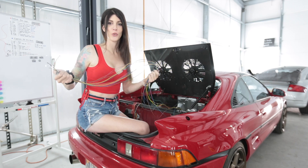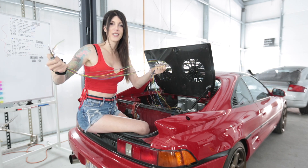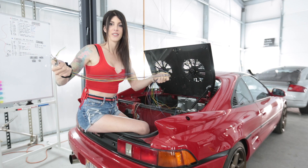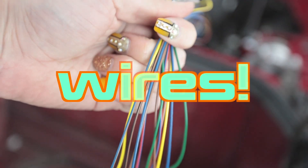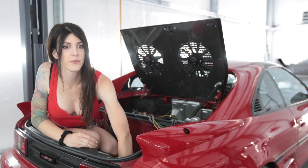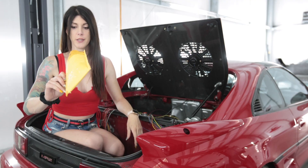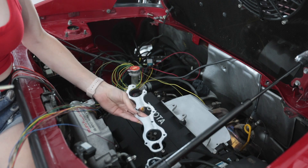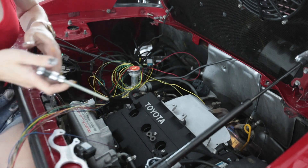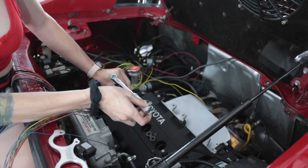I'm trying to keep it as clean as possible, but I don't know where else to stick the wires for the coil packs, injectors, IACV, and TPS — there's like nowhere else to route it, so it's not that big of a bundle. Somewhere down in my trunk of goodies — these right here are more Toyota OEM plugs, all for those circuits I just mentioned. Really wish I would have thought of this yesterday when I was putting this hardware in there, now I gotta take it back off. I'm that OCD — I literally used the torque wrench on this hardware, put it to 36 inch-pounds.